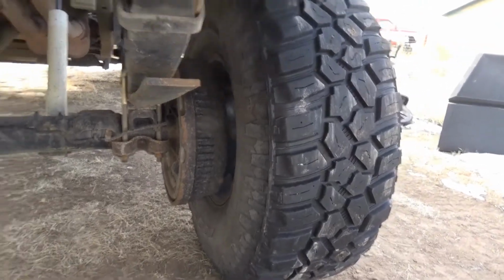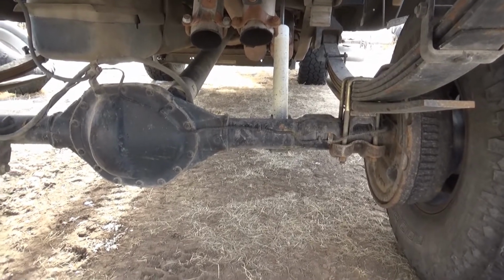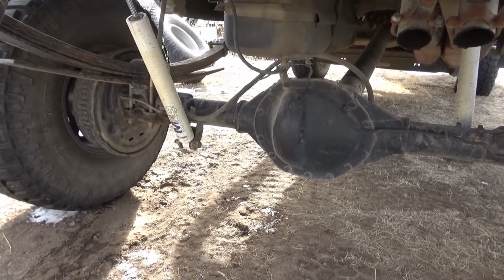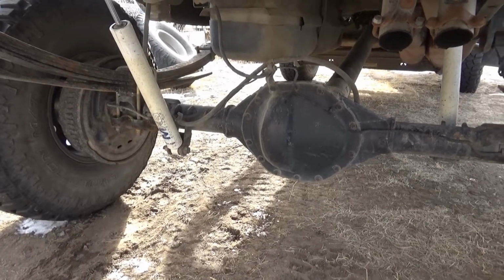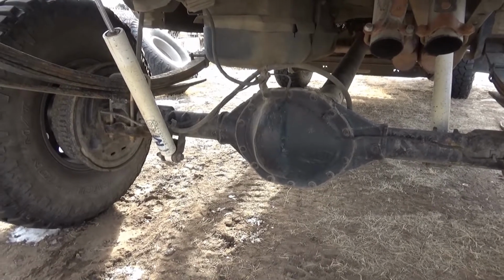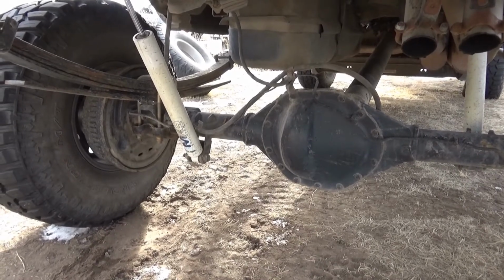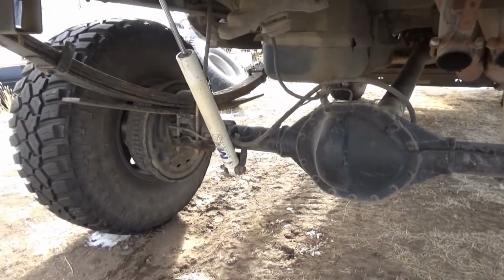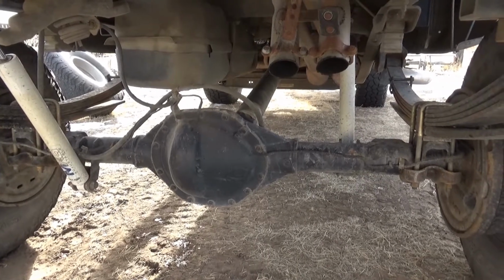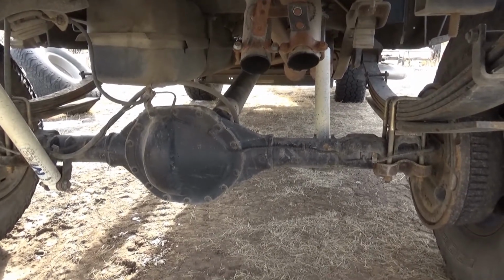And the reason why I put this on here originally was to get rid of the 373 gear rear end I'm working on right now. But I decided to go with this instead, because they got me by for what I needed, and I bought another IFS front end that was supposed to be 410 geared, but when I put it in four-wheel drive, the front tires turned a little faster, so I ended up with another 373 geared front end, and decided to go ahead and go with the 456 gears, and with the 35x12.50s, that'd be a better option than the 410, but I did like the 410. It did wake up the power band a little more in the motor than what it was. And just gonna see how the 456 is doing. At least I have a matching gear set for sure this time.